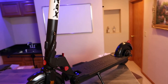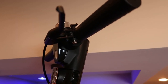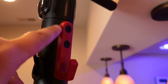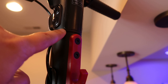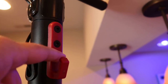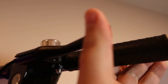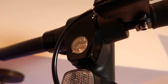To get this thing set up, all I had to do was attach the handlebar at the top. You can see there are just two screws to undo, then take a little rubber cap off, connect the three wires — two power connections and another wire for the accelerator control — then push the wires back down in the tube, put the hook attachment back on, and replace the two screws. Then all I had to do was connect the brake line to the brake handle so you can actuate the brakes.